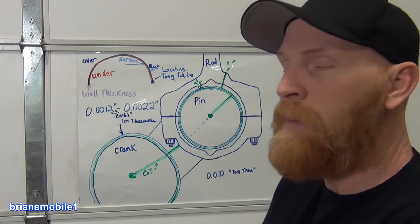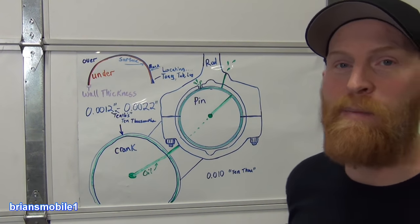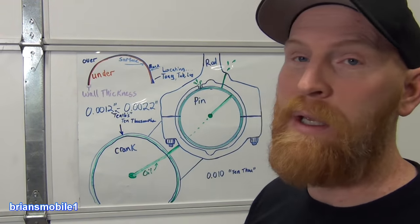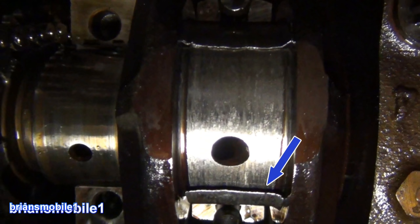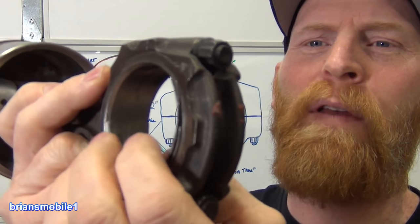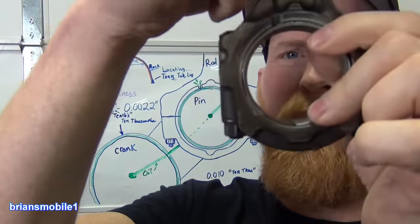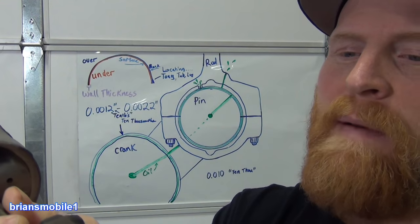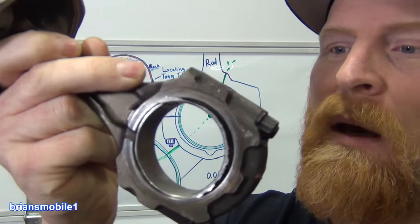I've got the crank and the block done — all cleaned up and ready to go — but you need to put the bearings in them. In the previous rendition of this video I said I did oversized bearings, because I've heard other people call them oversized once you turn the crank. But the correct term is undersized, because the journals for the connecting rod were all machined down due to severe damage. You can see where this piston's bearings are spun — they're actually riding over the top of each other. If they get right on top like that they can cause the engine to lock up.